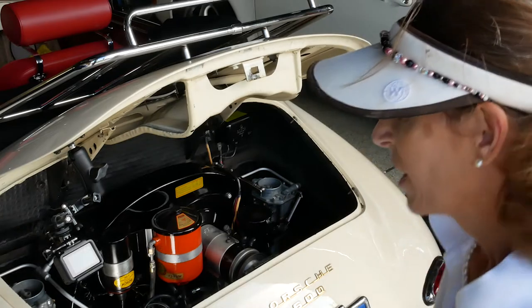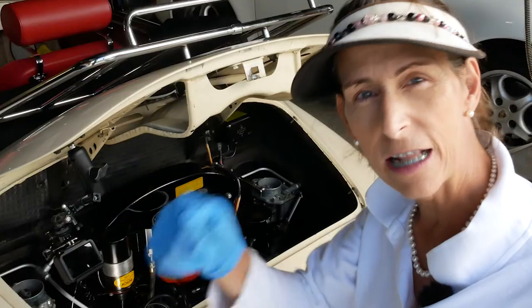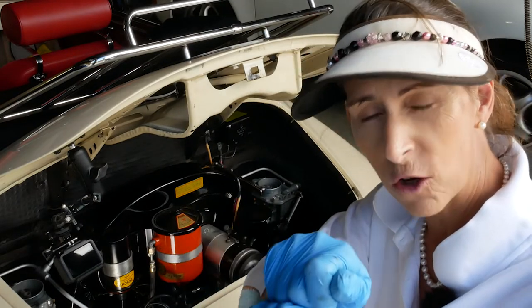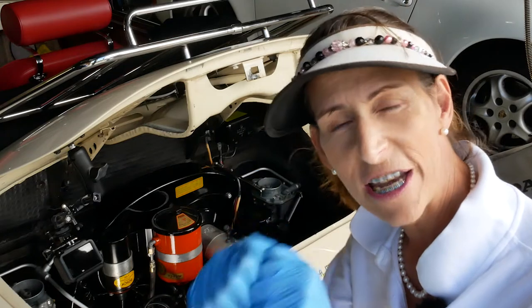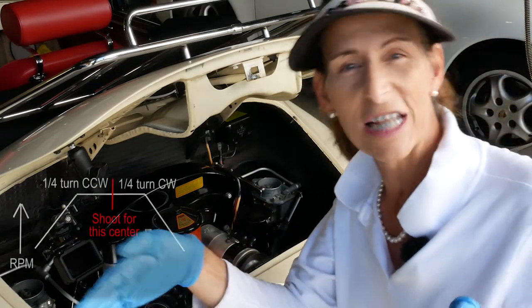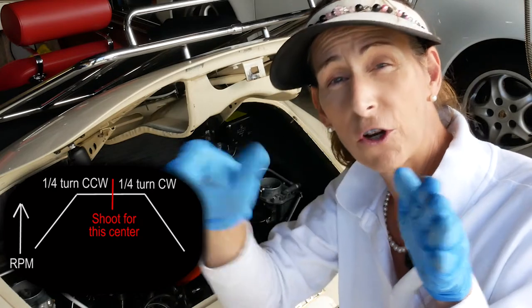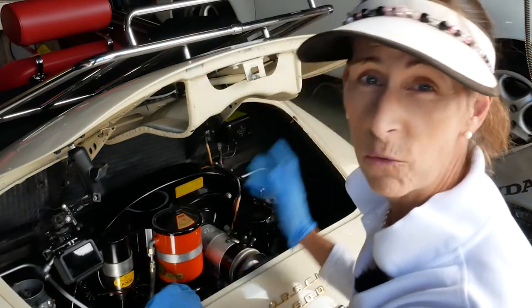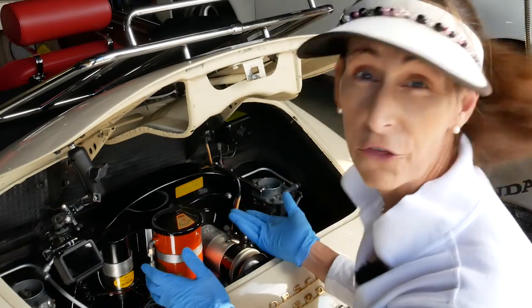There are air bleeds on the base of the outsides of the carburetor on each side. For every cylinder — all four of them — we want to be able to rotate that thing a quarter turn in each direction and not have the idle change at all. The RPM shouldn't drop. If they do drop, go back the direction you came from then go another quarter turn in that same direction, because you're looking for a peak — about a half turn on the top flat part of that peak — and you're shooting for the center. It doesn't really matter what order you do them in.